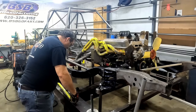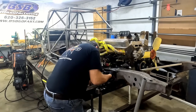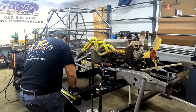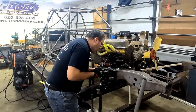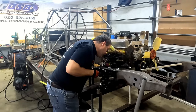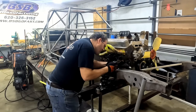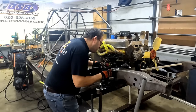All right, 37 and three-quarters — that's level. Now I can get this spring sitting right in this cradle. I'm going to get it centered. Now it's sitting flush in the bottom, centered. I'm going to measure across the inside of this spring — it's four and a quarter inches across the inside. Half of four and a quarter would be two and an eighth, so the center of this spring is right there. I'll do the same thing the other way to confirm center.